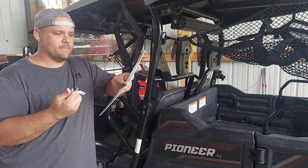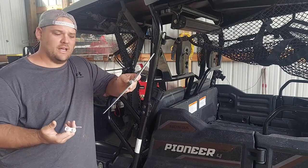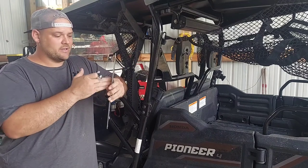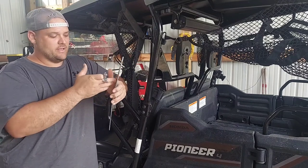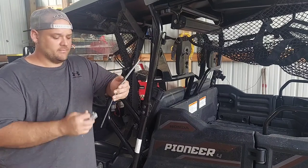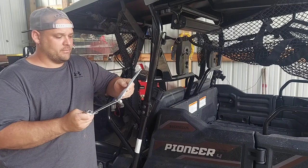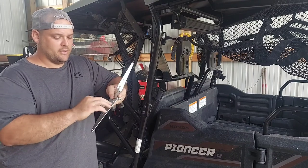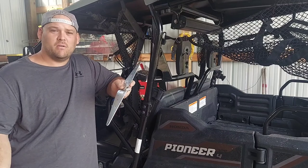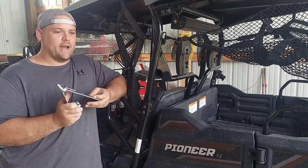It's a little U-bracket. I'm gonna try to make my own — pretty simple. It's a hinge. Cut it with a grinder, slit it. I know how theirs is designed — it has slits right there. Cut it off, put a slit down the middle with a grinder. Got a little U-bolt, I'm just gonna bolt it on, drill some holes in there, and probably do some serrations or something like that for a little bit of grip. I'm just gonna make my own.